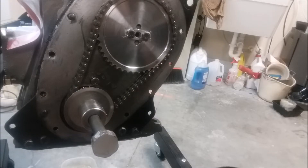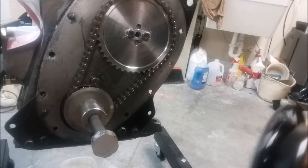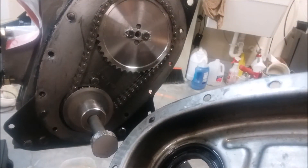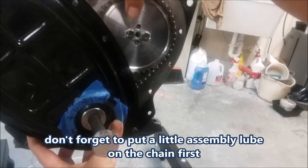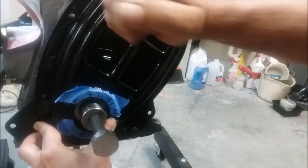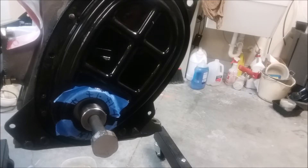People have been talking about installing the timing chain cover and having a problem — using an allen wrench, dental floss, or a screw to hold the tensioner down. I've never done any of that. Here's how I do it: I simply put it so the tensioner is sitting inside the chain, then just turn it and pop it on. It's as simple as that. I don't understand the need to do the other things.